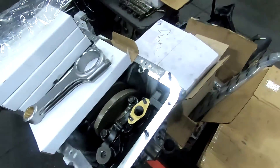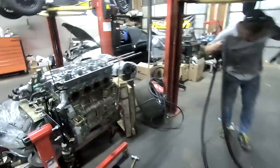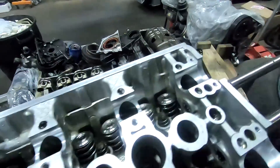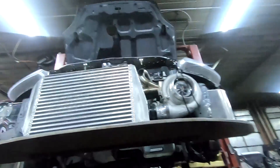I got the oil pump on there, rear main seal - starting to get the rods going on the pistons for Mario's. I got all the rocker arm assembly all out of it and Sean's cranking away on the radiator line stuff. He's got the radiator mounted back here and he's building lines to come up to the front so this thing can have a full-size radiator in with its forward-facing turbo manifold, six-inch intercooler - the whole nine. It's pretty rad, I'm pumped.